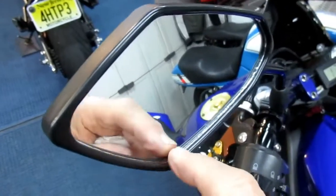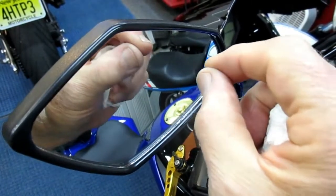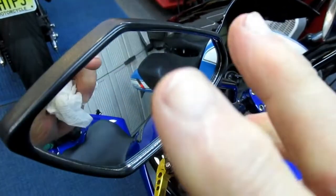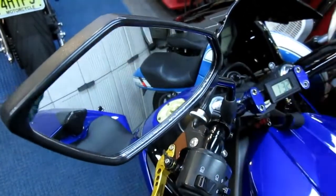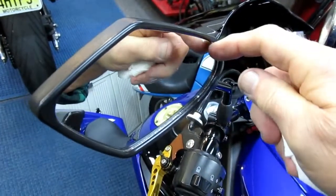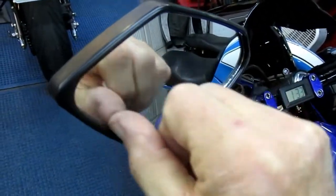Also, I want to turn around here for a second. I've learned that when you mask this off, this glass, if you call it glass, the stuff that comes from China is very prone to scratching. It must be a very low grade glass. I carry this around with me to wipe fingerprints off while I'm working on this stuff. But if you mask this and take your fingernail, I wish I had some fingernails, I can get my fingernail right in there and get a pretty nice edge on the finished product. If you take a razor and go straight up and down, the edge seems to be a lot more ripply than if you catch it right here with a number 11 X-Acto knife, or even better, your fingernail.